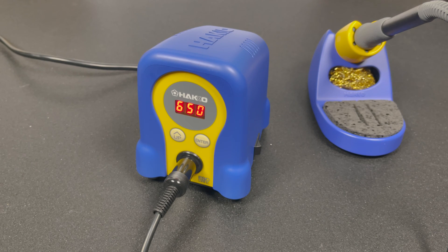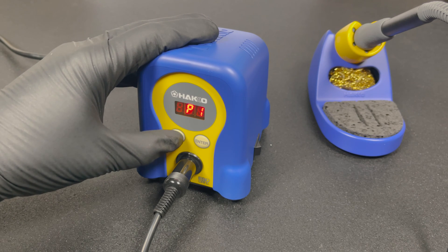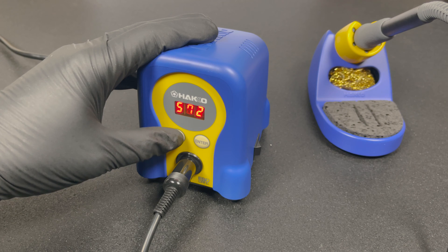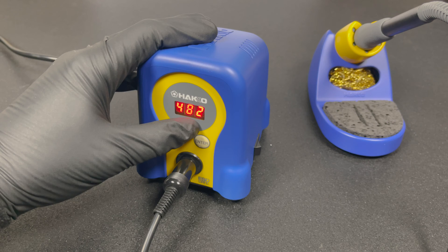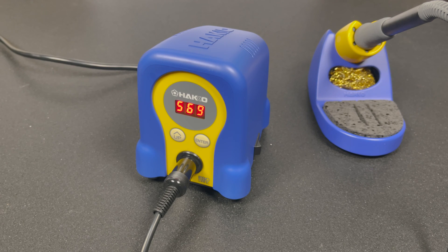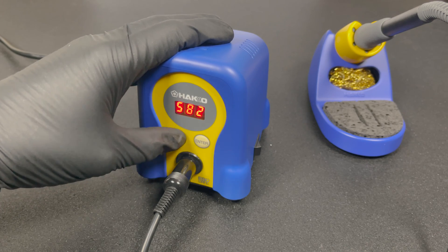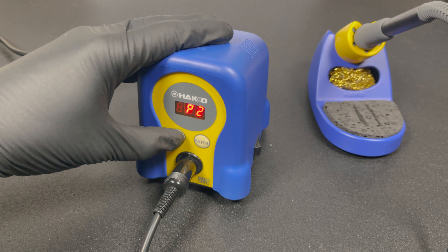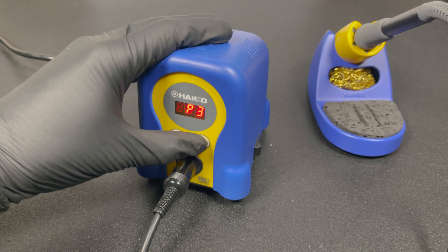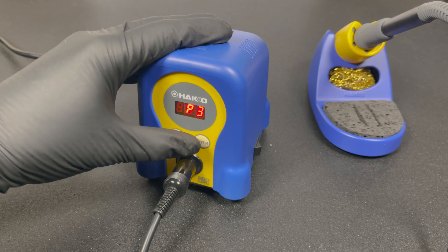Now let's say you've selected presets from the menu and want to customize them to the temperatures you use most. Scroll through them by short-pressing up — the pre-made ones are kind of odd numbers. Select the preset you want to adjust and it drops to the selected preset temperature. To change it, do exactly the same as adjusting the temperature without presets: hold the enter button and change the numbers to the desired temperature. It stays saved to the new temperature even when switching between different presets.